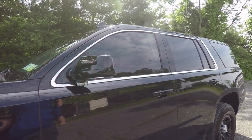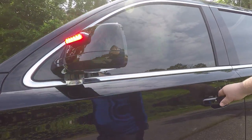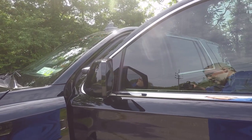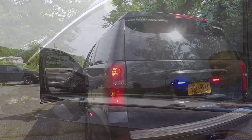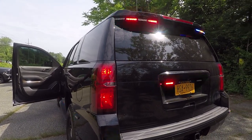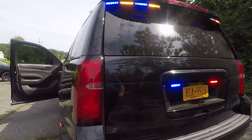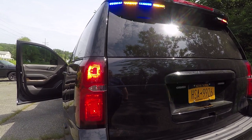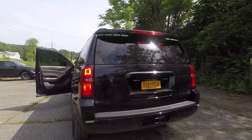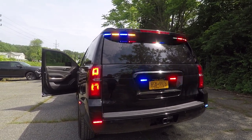Some of the safety features we've added to this vehicle: the mirror lights shut off when the door opens, so that you do not blind yourself when you get out of the car in nighttime situations. Another safety feature is that when you are braking or turning, it shuts off the lights in that housing, so the ring has stopped flashing and the reverse light has stopped flashing, so that a vehicle following you can tell if you are turning or braking. This is easily done with the Blueprint electrical system.